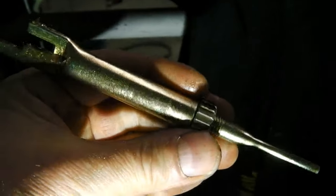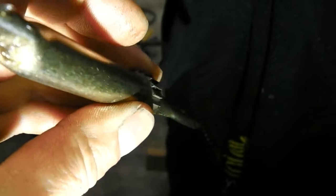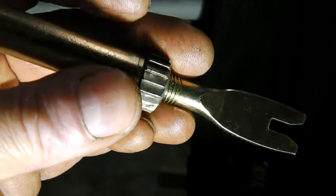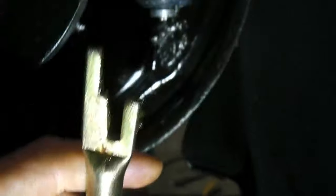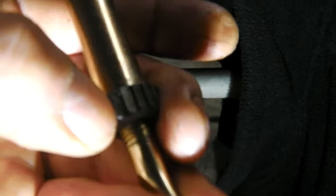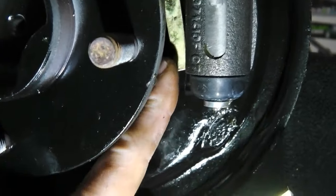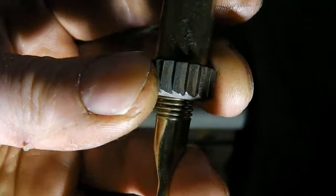There's two ways the ratchet wheel can fit, because the teeth of it are shaped so that this can clip back and create the ratchet. So you've got to be careful to put the wheel on the fork the right way round. It took me a while to actually work out how it does it, but if it's going this way, that arm lever's coming back, it needs to be able to clip backwards, and then on its upward stroke it pushes it. So it doesn't operate going backwards, it operates when it comes back up. So by doing that, the wheel can go one of two ways to suit it.